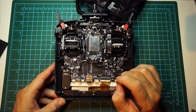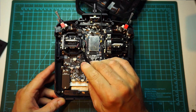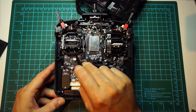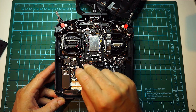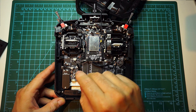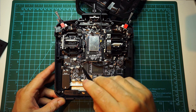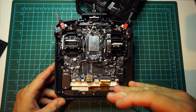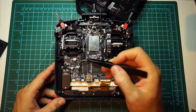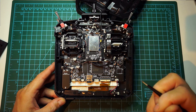This is the 5-in-1 module — on one side it has the 2.4G frequency and on the other side the 900 MHz. They went the last mile and used very high quality encoders for the gimbals. The gimbal no longer uses a potentiometer or a hall sensor but rather a special encoder which is faster than hall and has a very long life according to Alps, because these are Alps encoders. That's a pretty big plus.